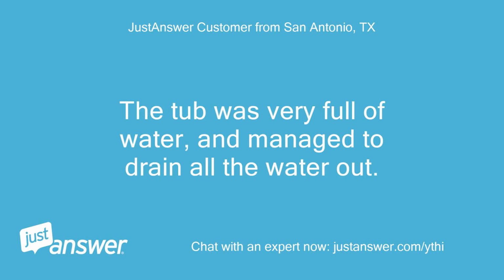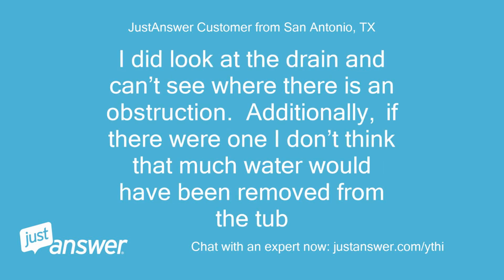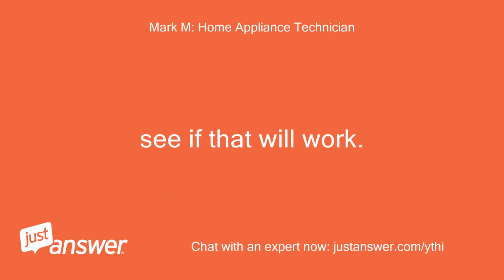The tub was very full of water and managed to drain all the water out. However, the cycle did not go into spin, so I just opened the door and wrung everything out to place in the dryer. I did look at the drain and can't see where there is an obstruction. Additionally, if there were one, I don't think that much water would have been removed from the tub. You can unplug the washer for a couple of minutes. Then plug back in and then try to put the washer into a spin cycle. See if that will work.